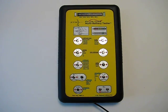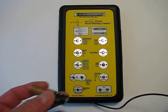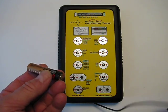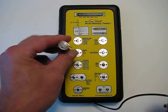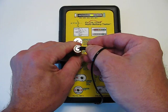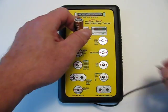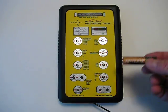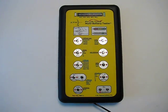An important point to mention: make sure you place the battery in the proper terminal at the contact point. If you recall, the alkaline battery went in this section and designated 40% power. If I put the alkaline battery where the rechargeables go, I will get a reading of — in this case — 10%. That's an improper reading because it's not in the proper spot. So make sure you take the proper battery and line it up where it is actually supposed to go to get a proper designation.